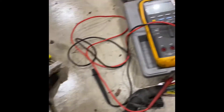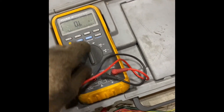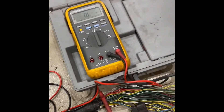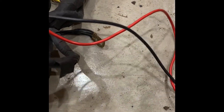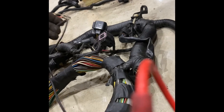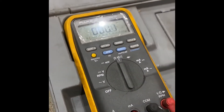One more thing I forgot to mention: the best way to figure out where all these wires go and which wires are connected is to use a digital multimeter set to ohms. You can use the Harbor Freight one that everybody has. You take both probes, connect them to the wires you're testing — let's do the black and yellow wire — put one probe on black and yellow here like that, then go down to the other black and yellow connector.